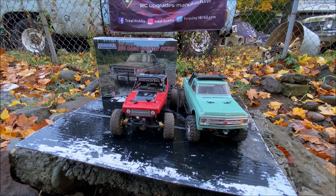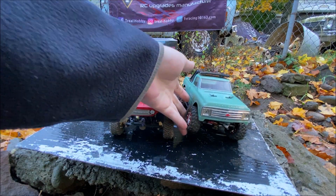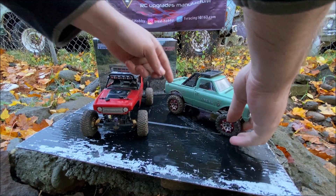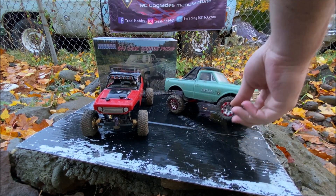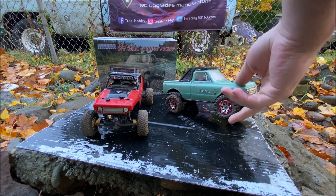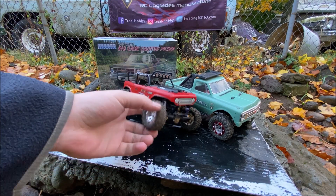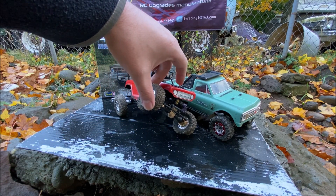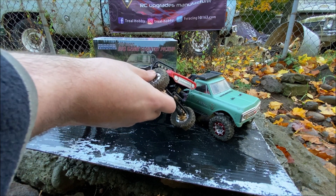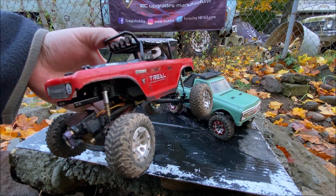Another question I got asked is Charisma shocks versus these. Well, that's a little bit of a toss-up. These have much better dampening but they don't get quite as much flex. The C10 has stiff springs on it — at max that's pushing it without holding it. I get about this much with these springs. With the dual barrel shocks I get that much flex and that's not quite maxed out — if I max it out I get about that.